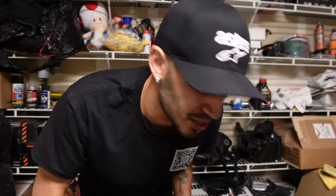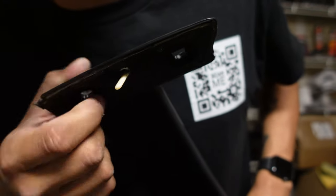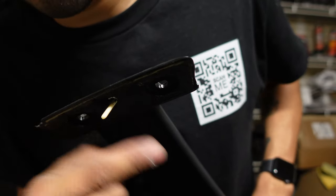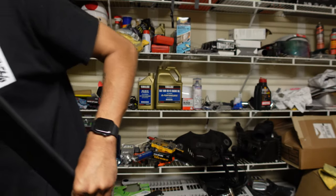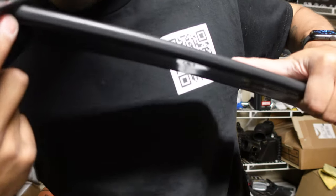When I say minor flaw, I mean very very minor. This is an OEM vane and look — it has these little pieces of plastic on the bottom. I'm obviously not gonna drill it off since I have a blob eye, not a hawkeye, and there are no pre-drilled holes. I'm just gonna break this off or cut it off with the Dremel. I also popped the end caps off — very easy. You just pull the clip from the inside, push straight up, and they pop right out.